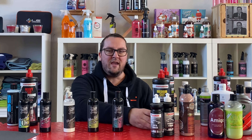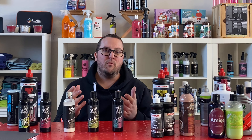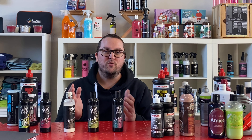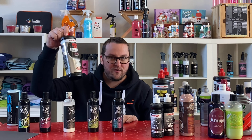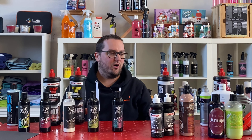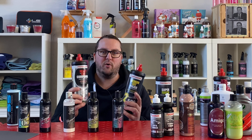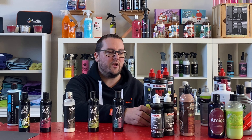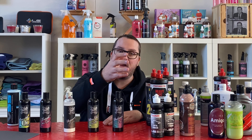There's something additional to talk about. In my opinion, one-step does not necessarily refer to a category of products — it more likely refers to the activity you're doing. One-step really only means that you are done after one step, after one process, after one pass of polishing. You don't need to first use a cutting compound, then a medium polish, then a finishing polish. This was an old understanding of polishing, necessary because those polishing liquids were inherently compromised and you only had a rotary polisher.